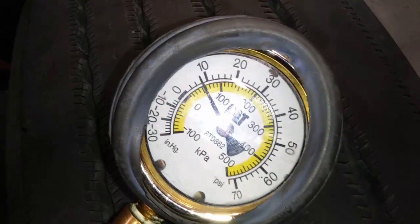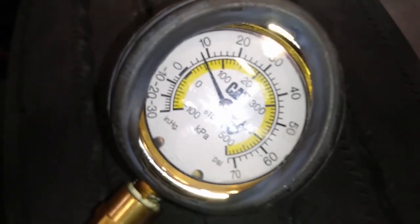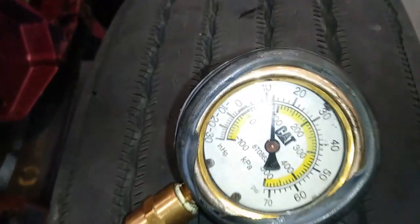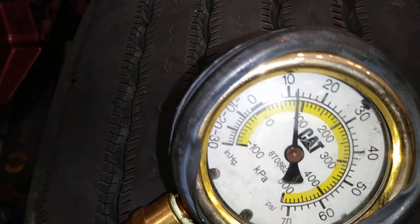Pressure is up. We're at 8 PSI on the gauge, and since we have to add 3 PSI for the gauge error, we're at about 11 PSI — remember the specification is 15. Taking our reading with the engine temp at 195 degrees, we're just over 12 PSI on the gauge. Adding 3 PSI, we're just over 15 PSI.